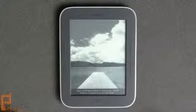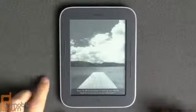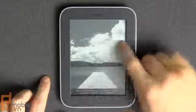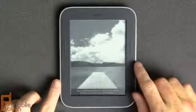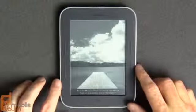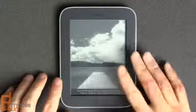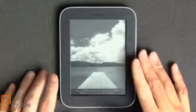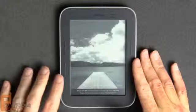One of the things that makes the Nook Simple Touch with Glow Light so power efficient is its e-ink display. Even though the device is turned off right now, we still have a perfectly readable grayscale image — a photograph in fact. That's because e-ink displays only require power to set the picture; they don't require power to maintain it. So there's no power running and the picture stays exactly where it is, which is in total contrast to LCD, AMOLED, or just about any other display technology.